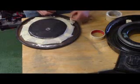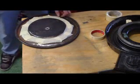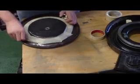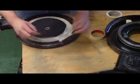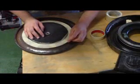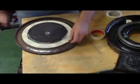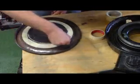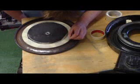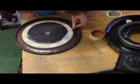Okay. Now you can take off the tape and you'll see the cover over it, nice and perfect. And if you see here, like I got extra ends of tape, I just take the blade again, go across, it'll come right off. You can always look around and you'll see little fibers. Like, I don't know if you can see that one right there. Don't try to pick it with your nail, just get your blade and go like that. It'll come right off. Those are what's going to get in your paint and screw you. Okay.